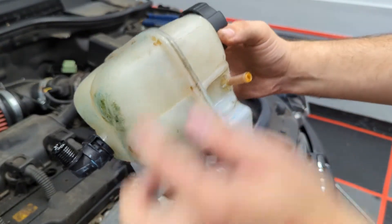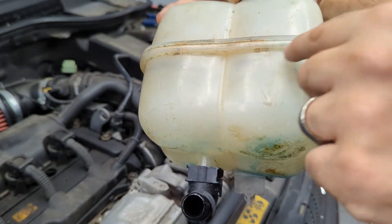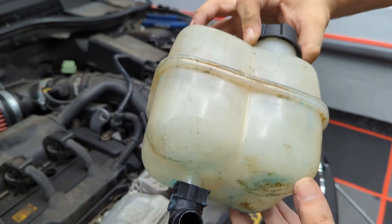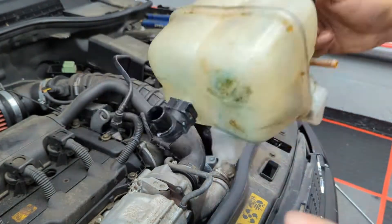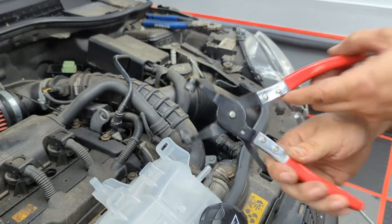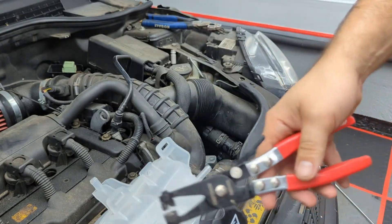I'm trying to find the failure point — I'm pretty sure it was the seam. It's pretty common. You can see it kind of coming down, dripping right here. Just enough — when it expands, I'm sure that's when it does it. Frustrating. The front little fitting here doesn't go anywhere, so don't freak out about that. This thing is about 14 years old, so I got my life out of it. I have two hoses to disconnect. Also, if you're doing this job, don't forget to relocate the little adapter on the bottom of your expansion tank right there — your hose goes on that instead. Side note: one of these hose clamp wrenches is amazing. It's ratcheting — you put it on the hose clamp, it holds it in place so you can slip it right off.